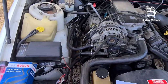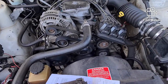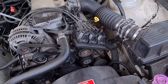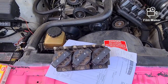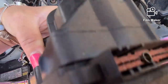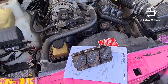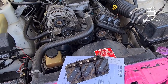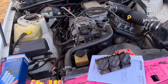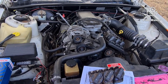I'm going to put some new black ones on, get rid of those ones, and put some new spark plugs in because it's playing up and it's got a bit of a miss. Possibly one of the coils could have gone as well, so I'm just going to throw a different coil pack on. And while I'm at it, I'm going to change the DFI as well, just in case the DFI is playing up.